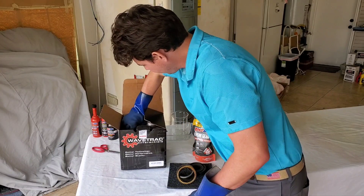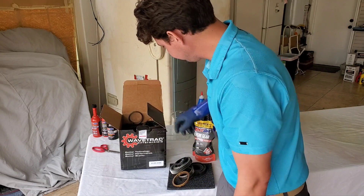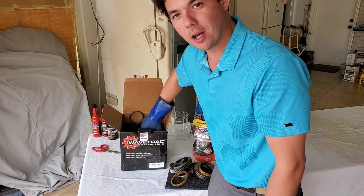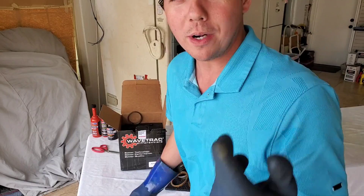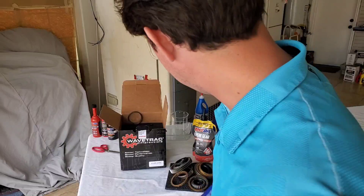Basically these parts all have to be cooled by one lubricant. There's usually no oil cooler in these. And the best, most important thing you can do is run 100% synthetic. Now, they actually call a full synthetic 'full synthetic' when it's only 25% synthetic or more. So if you've been buying full synthetic, you're not getting the real deal 100% synthetic.